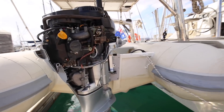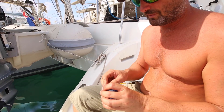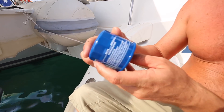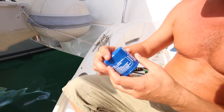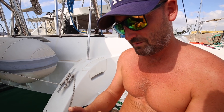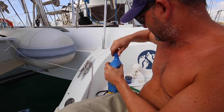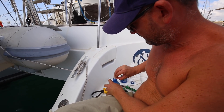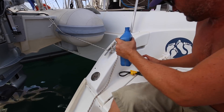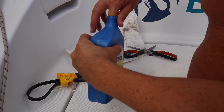You can see where the oil filter goes. Now what we do is put the new oil filter back on — this is the easy part, just goes on like that and we screw it on. We should get the right part number for that, though there may not be a part number. The only trick here is they say you should lightly lubricate the gasket so you get a nice clean finish. We'll use the new engine oil for that — just dab a finger in.